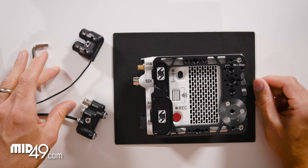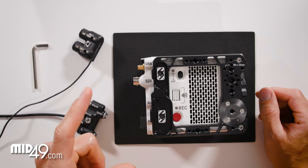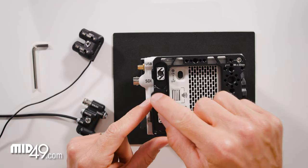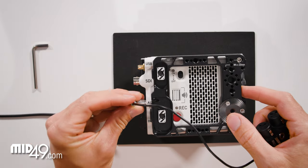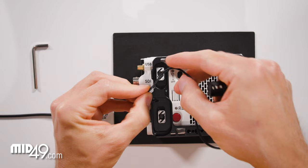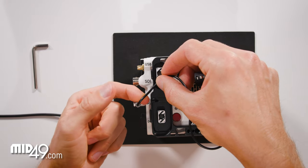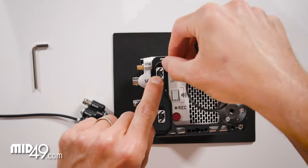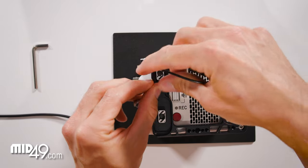In this video, we're going to route the cables in the side plate adapter recesses. We're going to start with the audio adapter. There are arrows here to tell us where to route the cable. We'll start by plugging this in, then start at the arrow and leave just a little bit of slack — enough to get your finger in there. We'll route it around the outside edge of this recess.